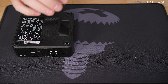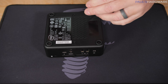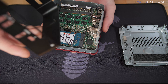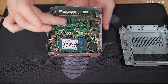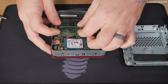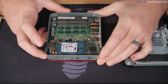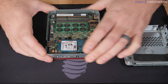I have already kitted this one out. Internally we can see a couple of SODIMM slots for memory expansion. I've already installed a Patriot memory stick — four gigs — and that should be plenty for our needs. For storage, we've got a 64-gigabyte SSD. This is mSATA, not M.2. Remember mSATA before M.2 became all the rage? mSATA looks huge now, by the way.